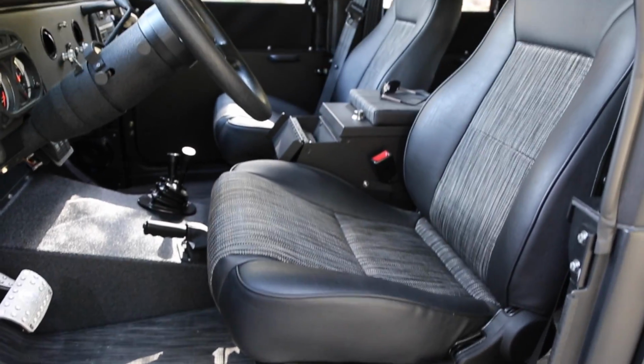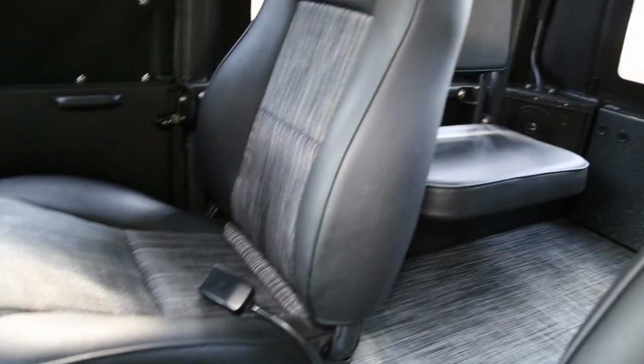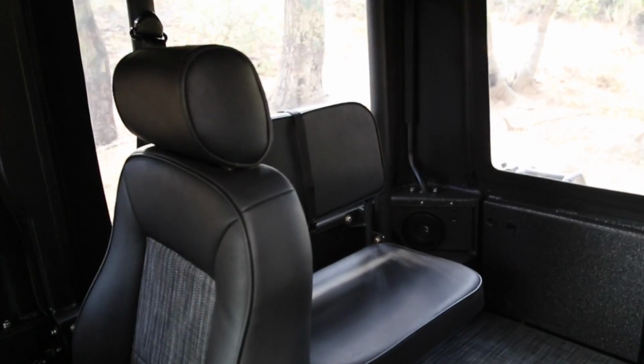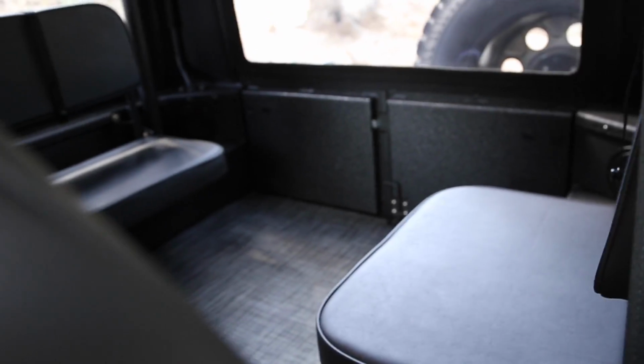And we're running 3 rows of seats with the Chillowich textile and seat heaters, the carbon fiber blankets in the first and second row. The third row on this truck is set up with the jump seat style. So they appear to be like the original 1970s cruiser seats, but they're not. We built them from scratch in a thicker wall material. We add about 4 degrees of rake to the seat back for comfort, and then we use a higher quality closed cell marine foam. And then, of course, the Chillowich textiles on all the other seats, flanked by Mercedes OEM vinyl, which is what we use.